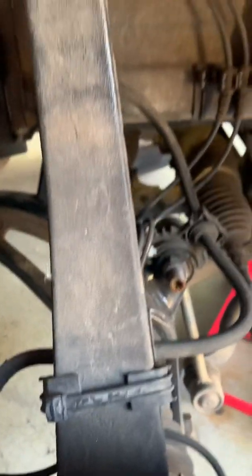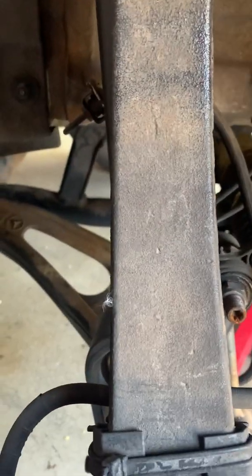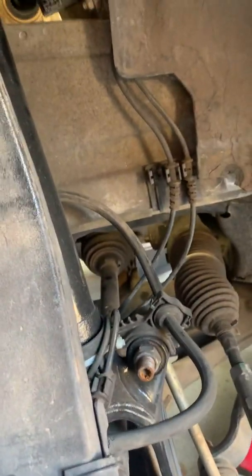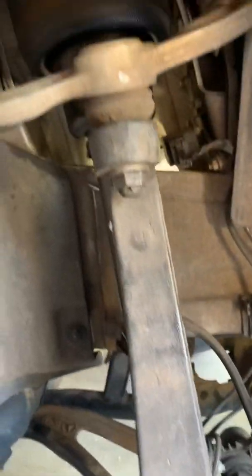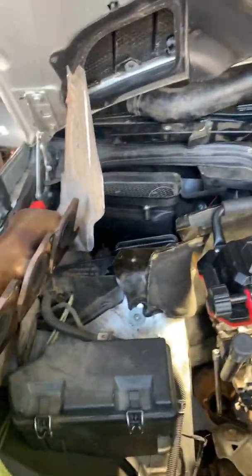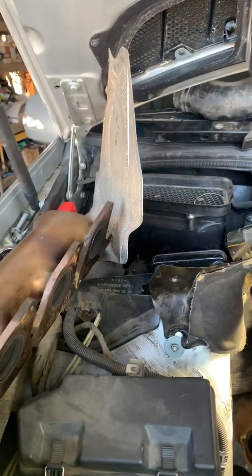It's not the toughest job, but usually the lower control arm needs to be loosened up to get enough clearance to lower the suspension and get the strut out. Plus, you're always taking a risk when you disconnect the lines up top with the air pneumatics. I found it a lot easier to just remove the upper bar and get the exhaust off.